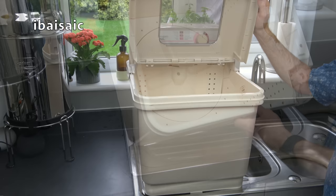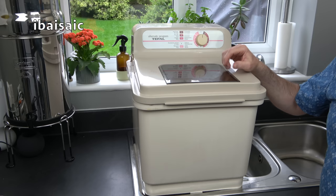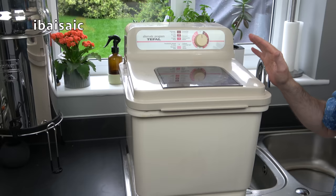This is a vintage machine — you can only buy it secondhand — but I can't help liking this particular Tefal Wash Boy. It dates from around the 80s, so it's over 40 years old and still works and does a very good job. Modern Chinese-made machines may not last as long. When finished, remove the fill hose, store the mains cable in the compartment, tip the wash tub to remove residual water, wipe it out, and leave it to air dry. If you're not going to use it for a long period, take out the agitator and let all parts air dry thoroughly before storing. Well, that's the end of my video on the Tefal Wash Boy — please give it a thumbs up, stay subscribed for the companion spin dryer video, and thanks for watching.